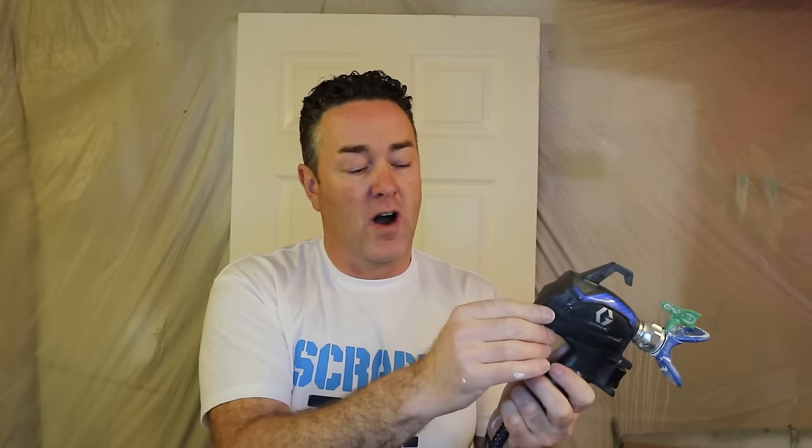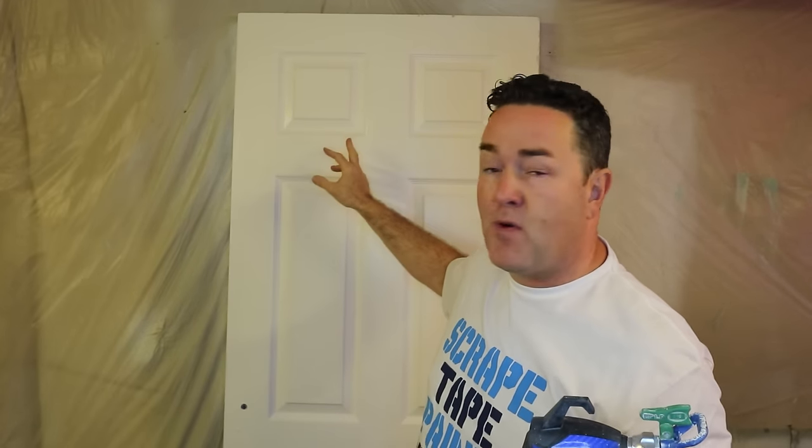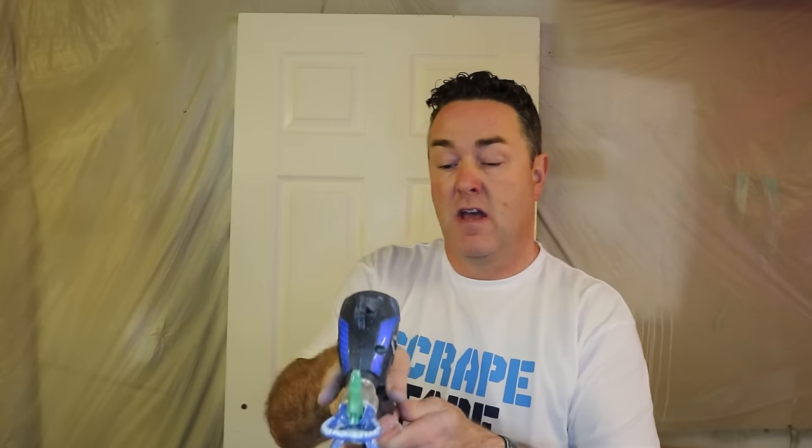I've tried this before and I've started on 4, gone up to 5, gone up to 6. And when I've sprayed, I've come back down to 5. And if you've probably watched all the videos, you'll see that everybody's spraying at about 5. But you have got the tolerance of moving that lower than 5 or going a bit more than 5 if you require. What you've got to get is a nice spray fan pattern with a bit of soft edges, without tails, with even coverage. So, dead easy. I'm going to go with the 5.